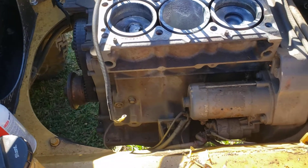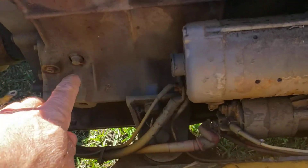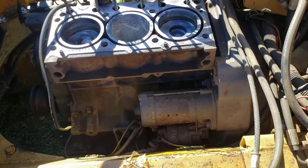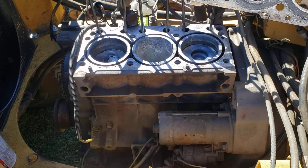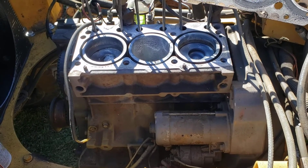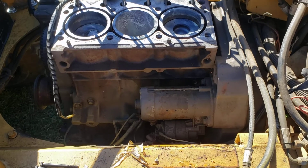I'm going to check the timing once I get it out — I need to order the timing tool so I can pull this out, stick it in there, and make sure it's timed correctly or if it actually jumped a tooth. Right about when it failed, it did a bounce, then made a hardcore miss sound, and right after that — blue oil everywhere.